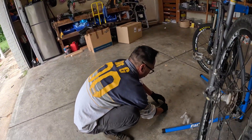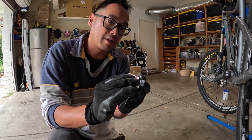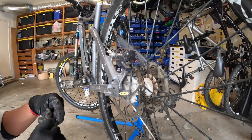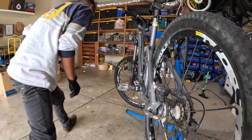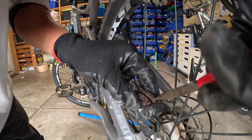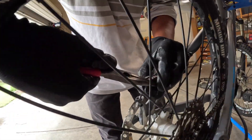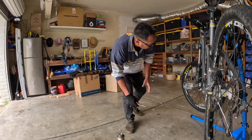I'm going to put some gloves on because those brake pads are still going to be super hot. We want to be riding, we don't want to be sitting here all day waiting for them to cool down, so I'm just going to pop them straight back in. Give that pin a little bend so they don't come back out. You can also buy upgrade pins which are better for some models, so that's probably worth looking into.